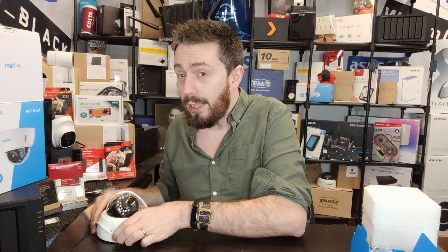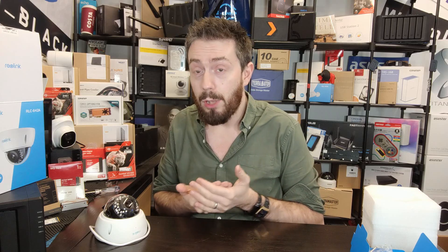This is a hardware review so I won't go deep into software, but when pairing this with a NAS, devices like QNAP taking advantage of the Google TPU — the Coral M.2 card, around $20-30 — give you an enormous increase in AI-supported services for facial and object recognition. The camera already has vehicle and human recognition built in, so with Reolink's own software you get smart alerts — rather than generic motion alerts, you know whether it's a vehicle or a human and can tailor your response. It doesn't go as far as full facial or license plate recognition, but it's solid for the price point.